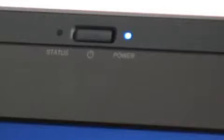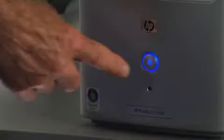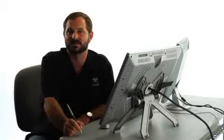First, turn on the Cintiq and confirm you have a power light. Then turn on the computer. This ensures that your computer sees the Cintiq as an attached and active display during startup. If you're on a Mac, the Cintiq should now show the same background as your Mac display, but nothing else. This is perfectly normal. If you're on a PC, you may need to enable it in the display settings.